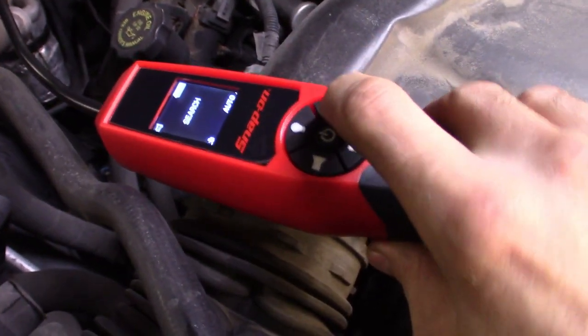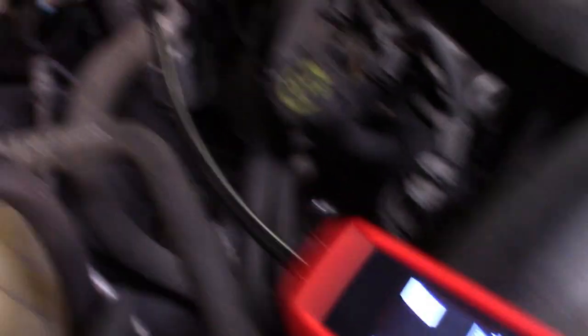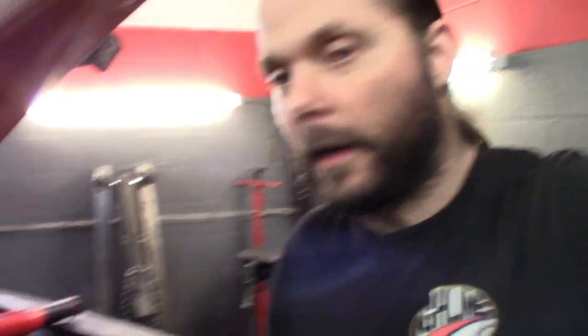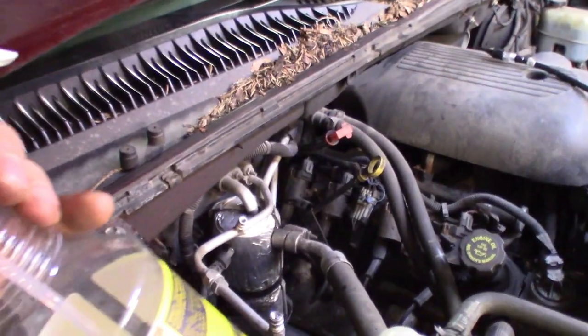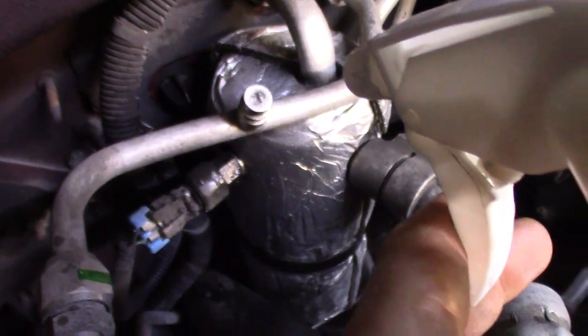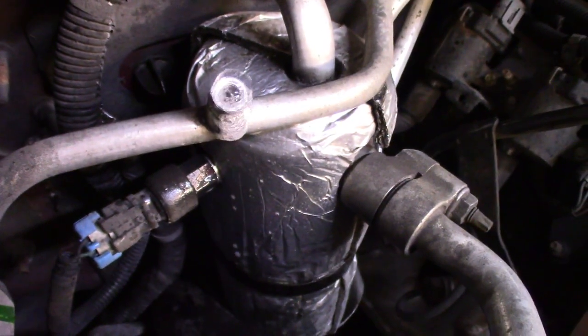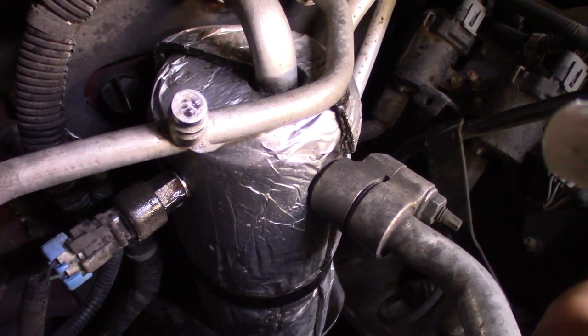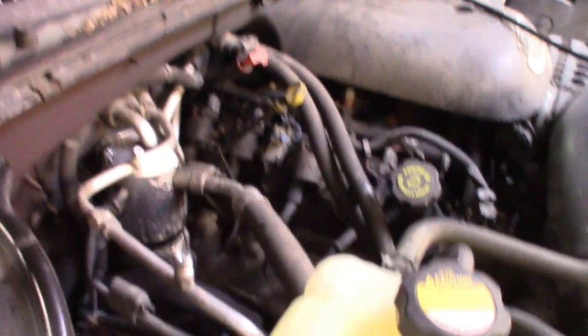We can see the graphing here — put it on the second screen, you can see the little bar coming across. Put it close, it doesn't even need to beep — you can visually see the leak. So now that we found a confirmed leak on that low side Schrader, I tried tightening it up a little bit and put the sniffer back on, but we're still beeping. Another way to confirm it — grab a little bit of soapy water and basically just spray some in there. Clearly we can see we got bubbles there. It's a definite leak and you can actually hear it once you spray water in there. Tightening it up didn't help, so hopefully it's just a bad Schrader. We'll evacuate it, change out the Schrader, and see if we can stop the leak.